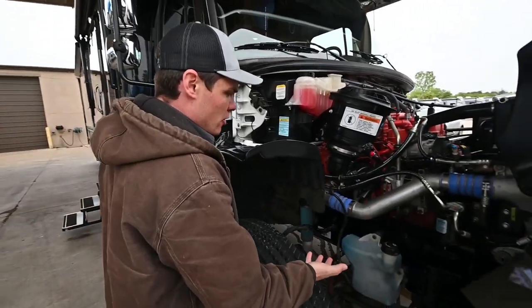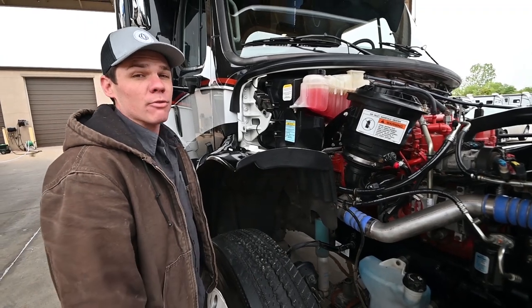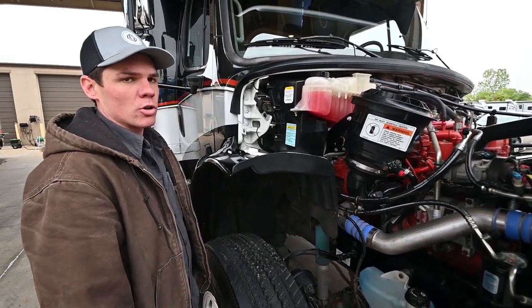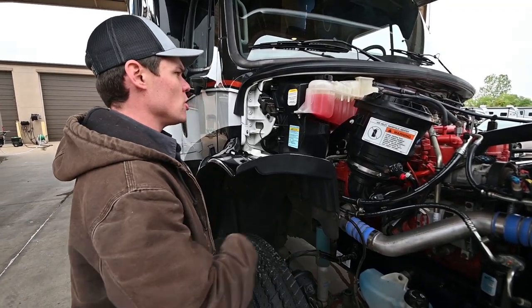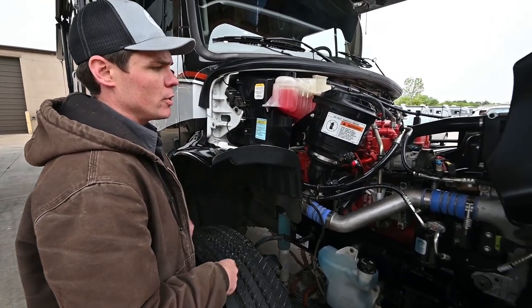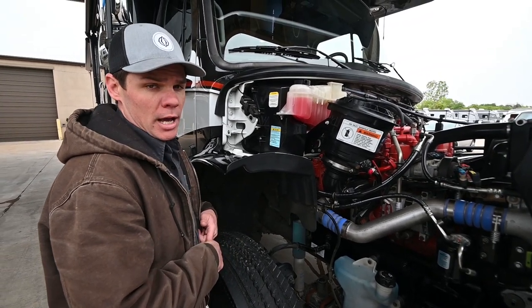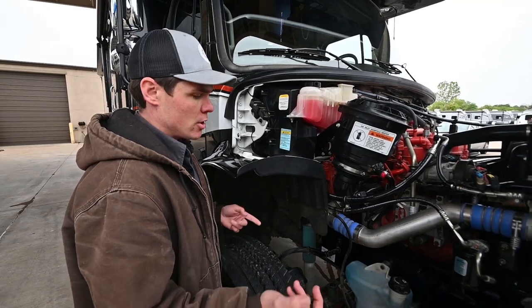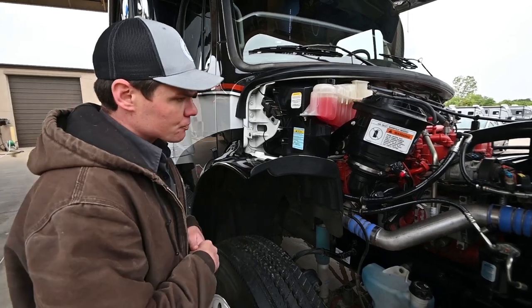Customers are usually going to be getting under the hood for windshield washer fluid reservoir. Most everything else can be handled at Freightliner as your first choice. Any mobile diesel mechanic would be able to work on this particular chassis as well — it's a really widely used chassis. We've got the windshield washer fluid filled up for you now. All the other fluids on the coach should be full and topped off. We had the chassis serviced, which included having your oil changed, all fluid levels topped off if necessary, and all grease points checked and greased.